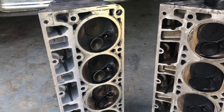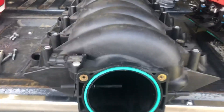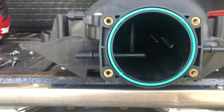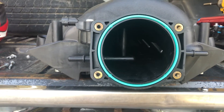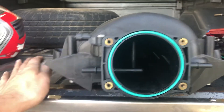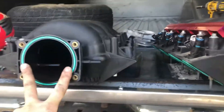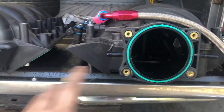That compression drop might actually help guys who are running boost. Here's the LS3 intake — from the dyno results I've seen, it makes just about as good power as any rectangle port intake unless you're wanting to turn it way above 6,000 RPM. I measured the openings: the LS3 intake is about 93 millimeters and the LS2 is about 91, so there's a bigger opening on the LS3.